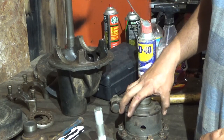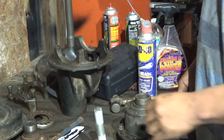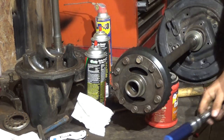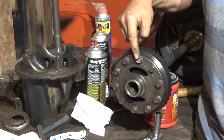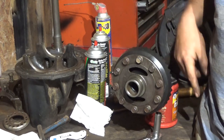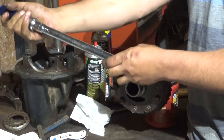Put the lid on it. I have another video about the torque specs and all that. There's really not much to know about assembling the actual differential. Just remember: red loctite, blue loctite on the smaller bolts, 27 to 32 foot-pounds, and 58 to 66, tightening in a star pattern. That's pretty much all there is to know.